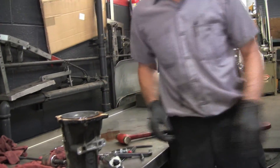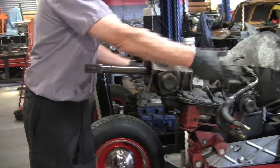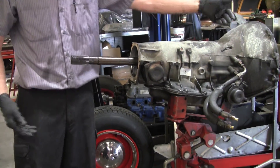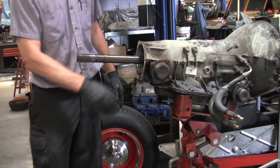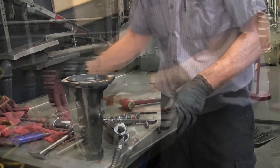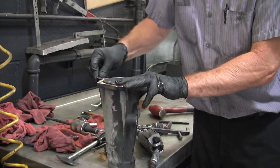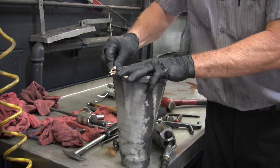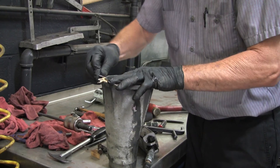This is a real common area for these to leak. A lot of times you'll do the reseal in the car — you'll put the pan gasket and all these seals on — but you'll always get a leak out of here, and it's just this gasket surface. They don't normally come with any kind of sealer on them, so you can use a gasket scraper here. It's just a little awkward sometimes, especially on a really petrified gasket like this.